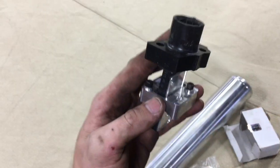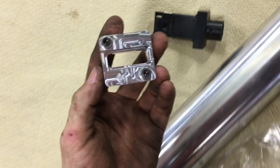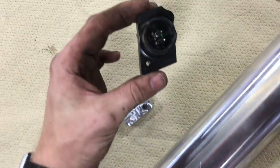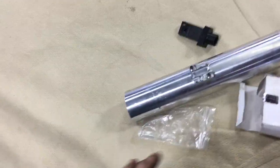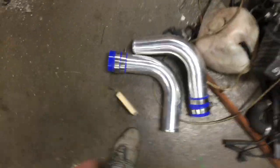Thanks for watching. One final thing — if you get let down and Miller won't send you a new MAF flange, this is just the standard Hitachi weld-on blade-style MAF bung, and it fits the Miller MAF perfectly. It's the perfect contour for a three-inch pipe. Make sure it's on 18 inches of uninterrupted smooth pipe, otherwise you won't get a good result. I'm going to mark it, cut a hole in it, and also shorten these tubes to have them welded onto the end tanks of the intercooler.